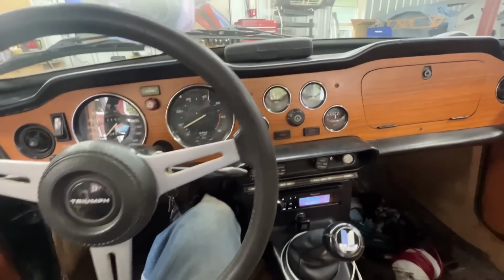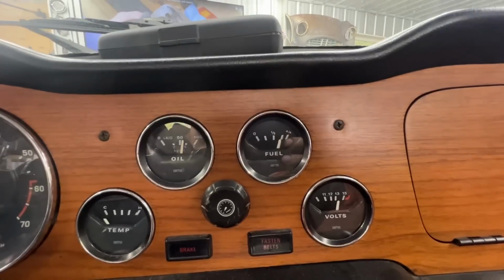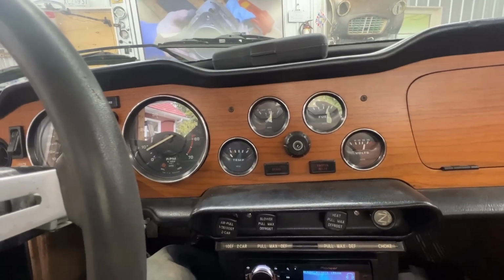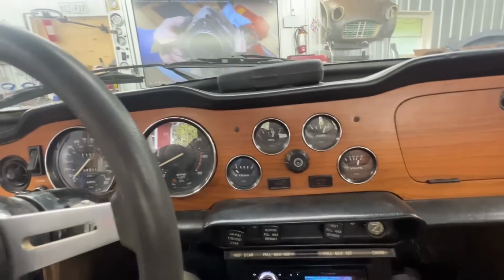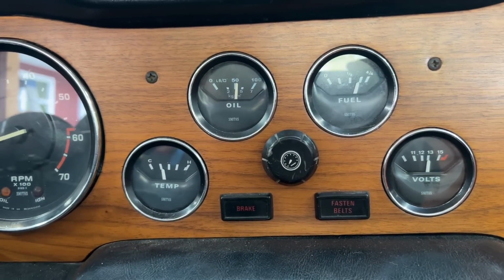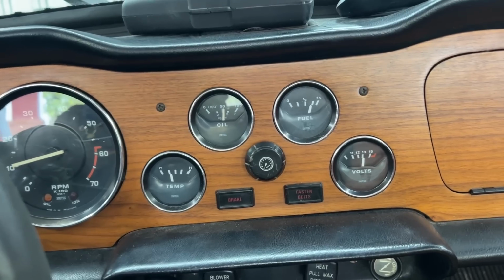And I realized the other day that I never showed you the gauges, if they work. So you see now the fuel doesn't show full anymore. It shows 3/4, so that's proper. The voltmeter works, and the temperature we will see later because now it's still cold. Yeah, the choke is back. All right, so the temperature also picked up and it's not fluctuating. David said before that the temperature was fluctuating. Anyways, she's idling a little bit high and I think she's running a little rich, but we will see.